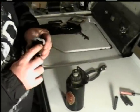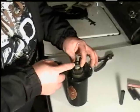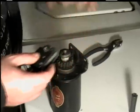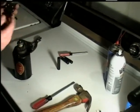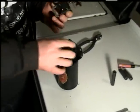When you start, put the big round part down and try to find that little spot where it slides up into the slot. Push down until it seats. Sometimes they're very hard to get on — in that case you might use a little carburetor cleaner to clean out the crud, then put a little lubricant on it to help it slide down. Heat, moisture, and outdoor exposure can cause it to stick.